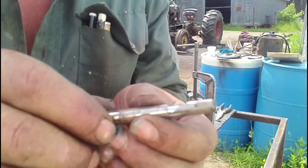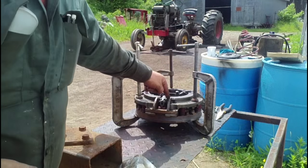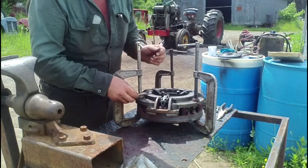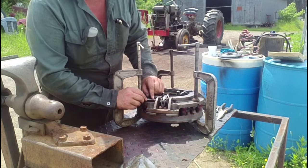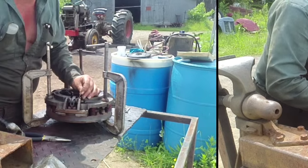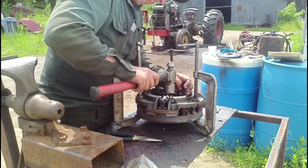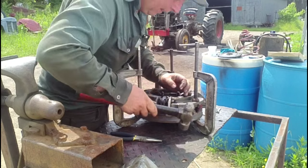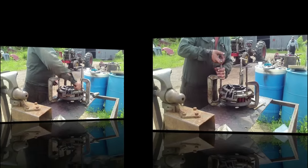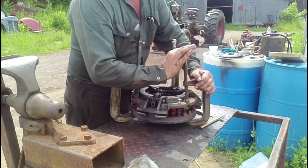On the pin, it's got a notch through. You've got to make sure you line that up with the hole in the pressure plate for the pin that goes down through, that locks the lever pin in place. It goes towards the outside, straight vertical. Line it up in the lever and push it home. She's locked in now. Now it's time to replace the bolts that hold the two halves of the pressure plate together. We can release the clamps now. And that is ready to put back on the tractor.